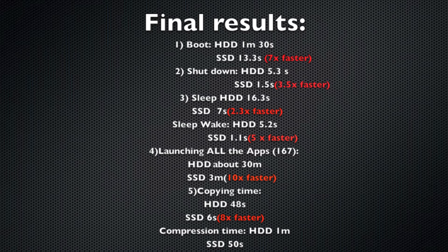When copying a 1GB file — the Airport Express movie — the SSD was 8 times faster. For compression I got similar results, only a 10-second difference. This is because when you archive or compress a file, the component most used is the CPU, not the drive. The drive is only used to write the new file; the actual compression process is done entirely by the CPU. So that's why the difference is so small — only a 10-second gap.